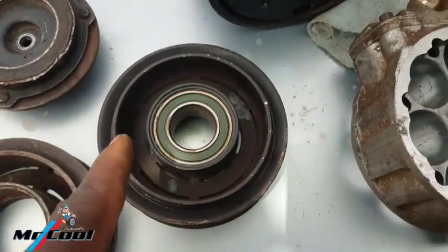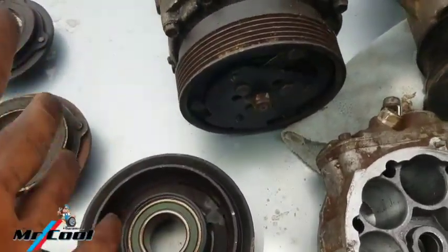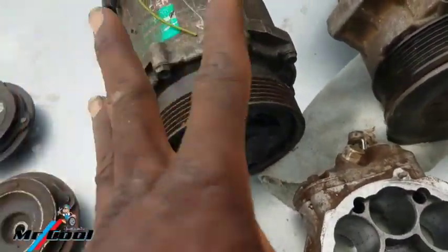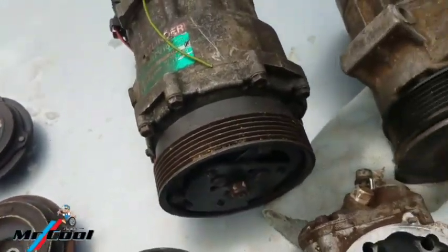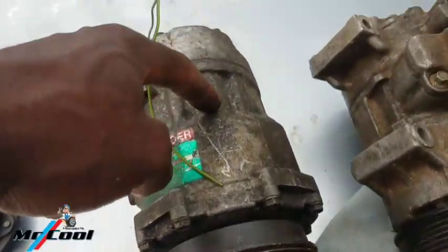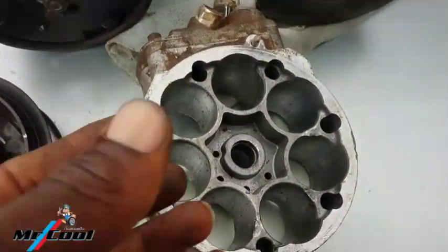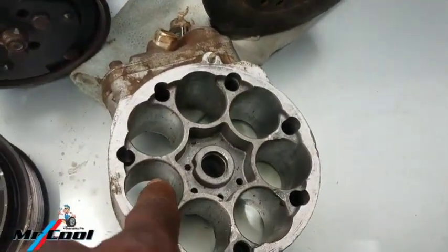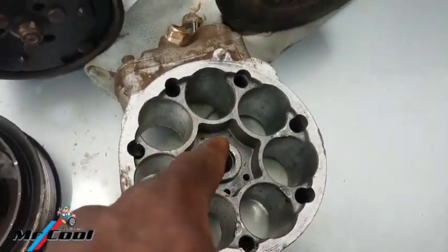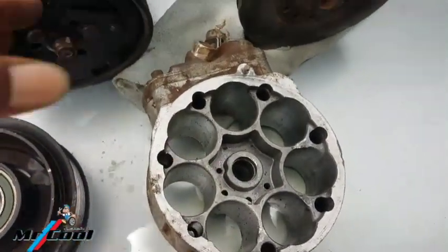But in a situation where you press your AC button, start hearing the rattling noise, and the cooling drops dramatically while the noise is still there, then there is every 90% chance there is a structural failure inside. Those structural failures can be attributed to broken pistons — there are pistons inserted into the cylinders — and when a piston breaks it leaves a lot of particles and debris in the system, creating further disruption.